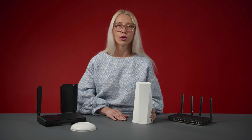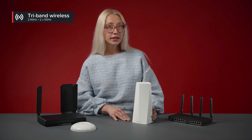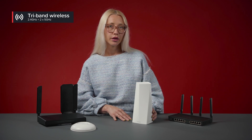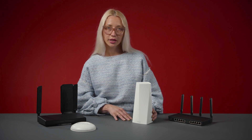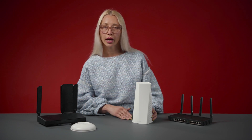The Audience features 2 Gigabit Ethernet ports, so you can connect wired devices or even a home automation hub. And instead of dual-band, the Audience is a tri-band device — it transmits in three different frequency bands simultaneously. Usually the third extra 5 GHz band is used for mesh technology so the Audience units can communicate with each other. But if you're using only one Audience, that third band can be used for all kinds of tinkering.